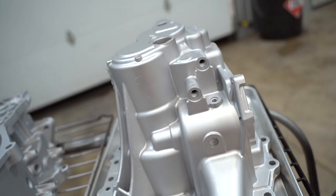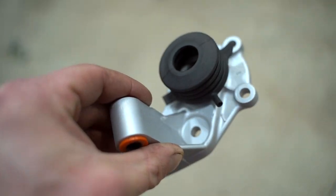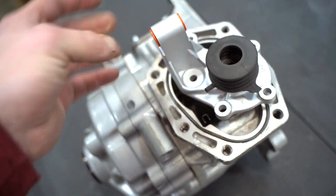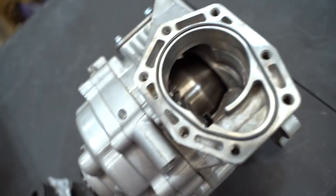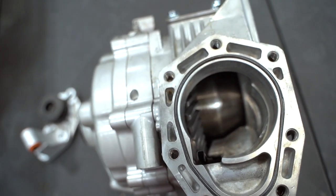Wow. I'm stoked. I just realized that we now have a new problem. Let me show you guys our problem. It's not a big issue, but it's an issue that came up and I don't like it. Look at the difference. It wouldn't be a big deal if the transfer case didn't bolt literally right onto the transmission, so they're side by side. Transfer case is here, transmission literally bolts under here to the transfer. This is not okay, I don't like this.